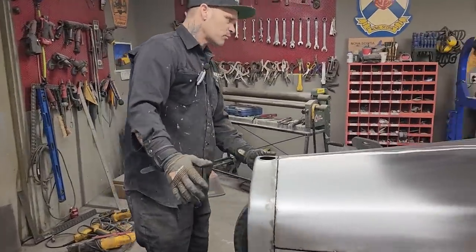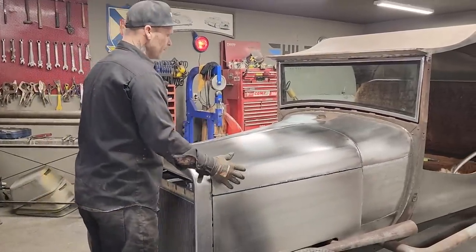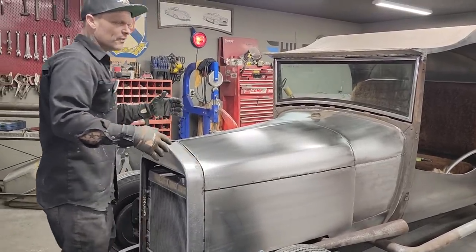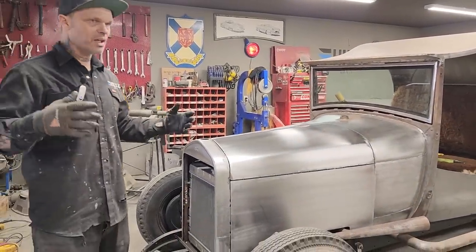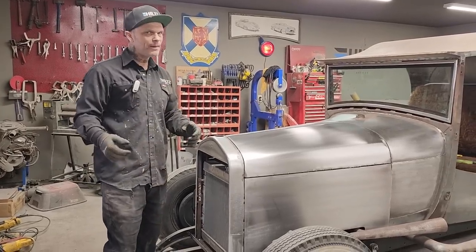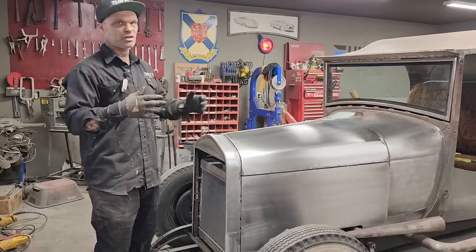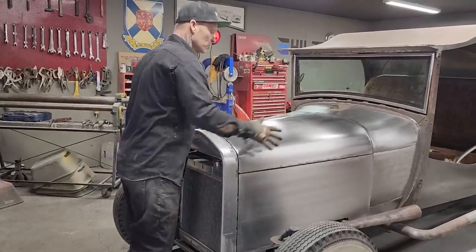shell. And what is going on is I've got it tacked there, so when I'm making this hood, I want everything to stay in shape. I'm using the car or the truck as a buck. So if you're into making chassis, or if you're into making something that you want to stay right and square, you use a buck and you weld it together. If you do not, generally what happens is you get all out of shape, and then you're in sort of a mess somewhat, because you're trying to go back and repair what is not straight and what's right. So as I tack everything on, that is the construction of the hood.